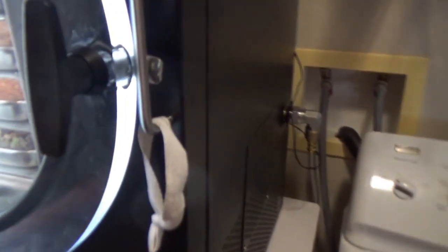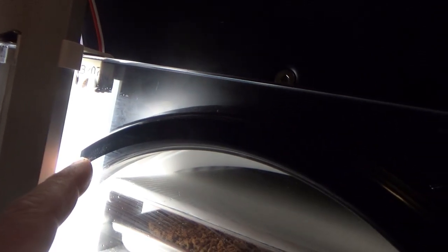And one other thing is the door seal. Sometimes there are issues with getting the door to seal properly, and people are pulling their gasket out. There's this ring here. You can see this extra thickness of ring here, which is a pressure cooker ring. You can buy two of them for like 15 bucks. So I bought a couple, put one on mine, and shared one with a friend. And that keeps the door gasket out far enough that I never have to adjust the gasket. It's just simply a matter of making sure the door is adjusted properly. Once it's done, there's no more pulling this out.